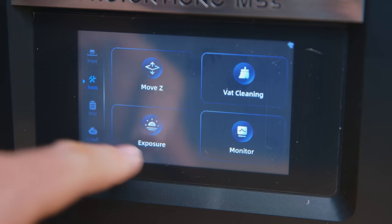After entering your home Wi-Fi settings in the app, it's online — but before connecting to the printer's network you must press a refresh button on the Wi-Fi network screen on the printer. On the M5S this wouldn't actually work until one time it just randomly did, and on the M5, despite refreshing and seeing network credentials on the printer, my phone never found it. All this allows you to do anyway is monitor the printer remotely and get notifications — and whilst you can send some files, you need to do it from Anycubic's own store of STL files. The Saturn 3 Ultra has an external Wi-Fi antenna, so it's not as clean looks-wise, but setup is easy — you just use the on-screen UI to locate and connect to your home network. When you slice in Chitubox, you choose Network Send, select your printer, and it sends files to internal memory so you can start them remotely.